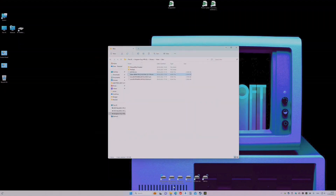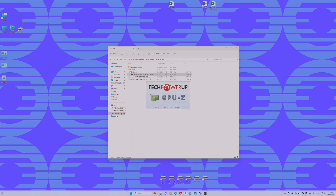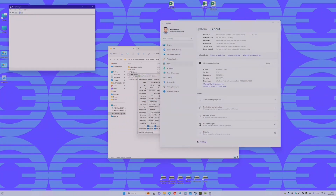After flashing, you will be prompted to reboot your system. Everything will work including the LED lights of your video card. The vendor name however will be changed from ENA to GALAX. The video drivers will be installed once again, but it will behave like the same card — it was unbranded before and it's still unbranded.